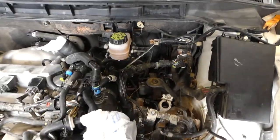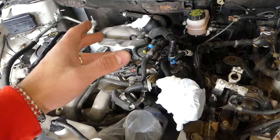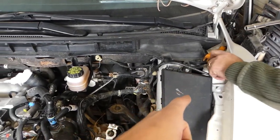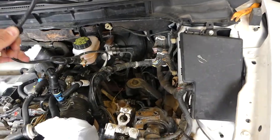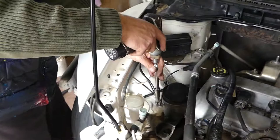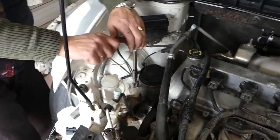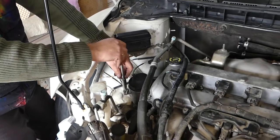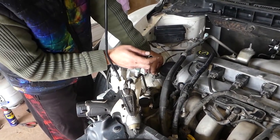In order to pull the engine out we need to disconnect the wiring harness. Usually there is a ground wire you can disconnect — the one that goes to the battery, you can see this one here — and that way it will stay with the wiring harness. There's probably another one closer to the passenger side as well. Check it out because it's very common to have two ground wires. We got this one there now.